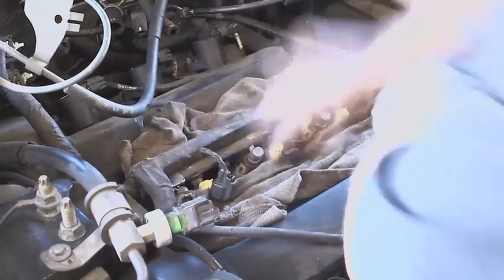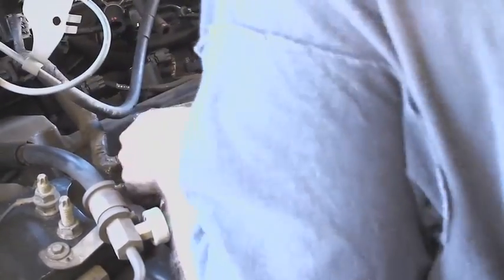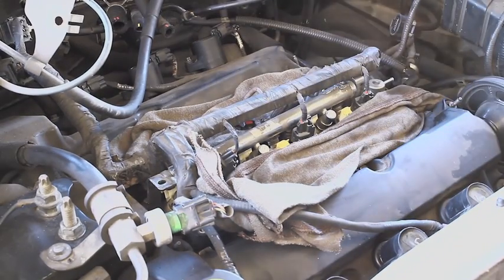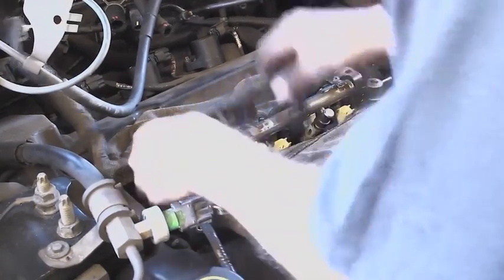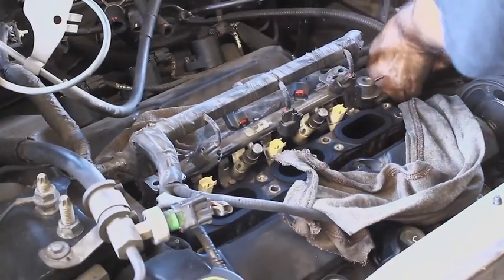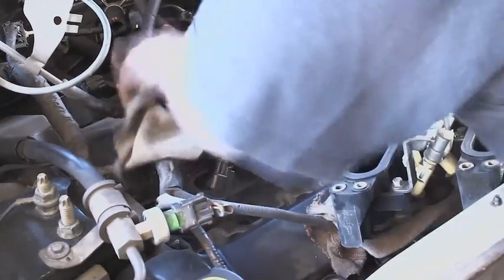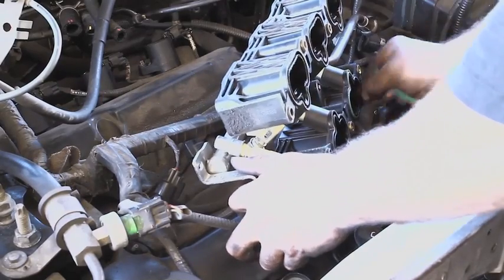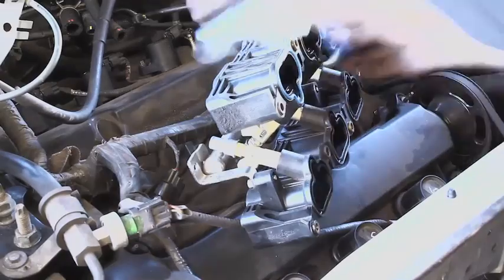Those are the connectors for the fuel injectors — they came off the fuel rail. The wiring harness connects to the fuel rail. I'm marking with a paint marker set. I needed more actually, but marking so that I could keep track of my pieces — hoses and connectors. Individual plugs for the ports would have been better, like rags, paper towels, or socks, which I'm gonna do next time.